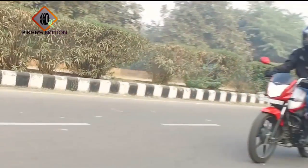But in the case of a motorcycle, since it is not a stationary object, fans are not necessary for the functioning of the fins. As the motorcycle moves, cool air from the environment comes in contact with the cylinder, and with the increased surface area of the cylinder, efficient heat exchange occurs, resulting in cooling and the optimal temperature being maintained within the motorcycle engine.